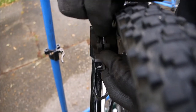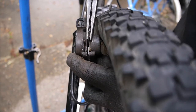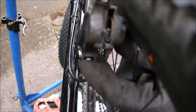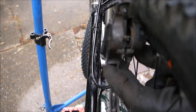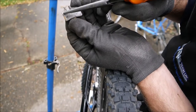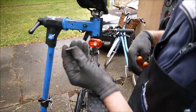Pulling the pad out — there's a bit of rust in there. You can see that the pad isn't even against the piston; the circular piston has a wider gap on one side than the other, so it's coming out at an angle. Looking at the pad itself, one side is actually down to the metal — it's touching the metal. So you've got pad material on one side but that side is completely gone. It's worn tapered because that piston isn't coming out evenly. This is cast alloy and it's starting to corrode — it's quite an old system.